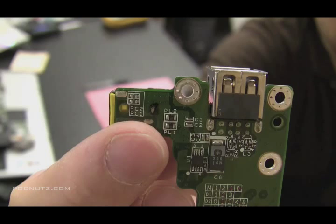And if you look close, you'll see that it's burnt right at the positive point there on the circuit board — there's a brown, black outline. That dark little cloud right above my finger with the little piece of silver in the middle, that's where the positive lead from the power jack attaches to the motherboard. That's the spot that's loose, and when it gets loose in there it starts to get real hot and burn up. So if we reattach that positive lead to that part of the motherboard, we will be able to restore the connection with a good strong solder connection, and that will fix this computer.